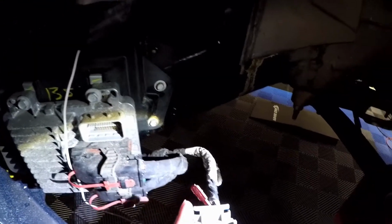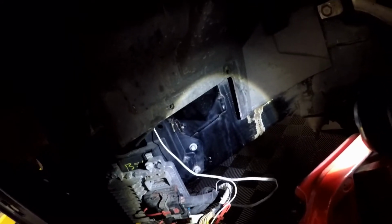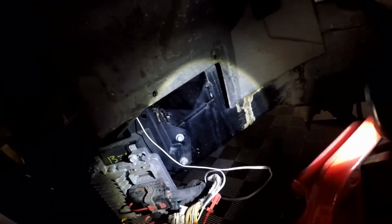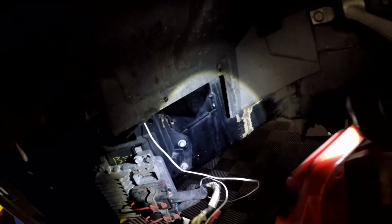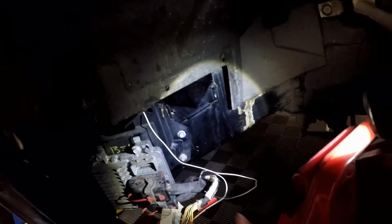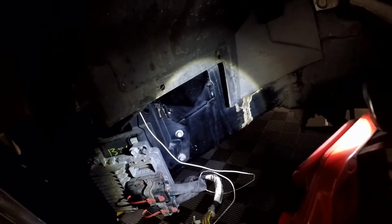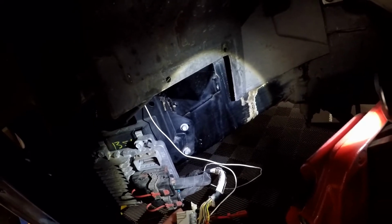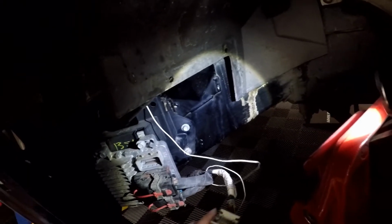this wire into here. Okay guys, I finally got this back together. What I had to do was take the green pin out, push the white pin, like I showed earlier, drill the hole through slot number 4, push the pin all the way through. This took me a while. I actually had to cut back some of the tape just to get extra wire length to be able to move some of the pins out of the way and push everything back. So you push the white pin through, and then you put this outer case with the hook back on it, slide your green, lock it through.